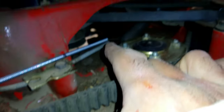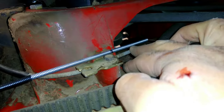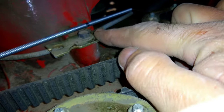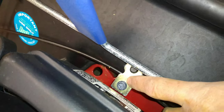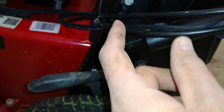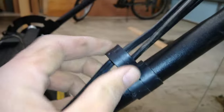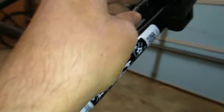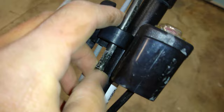Now it's time to fish the cable through the front of the deck and up through the handle. The first spot near the spring looks like it has some tension on it — we want that cable sleeve to stay put — so I put a mark on the new cable with a Sharpie to know where the sleeve needs to stop. There's another spot where the cable feeds through with no tension, then it goes around a corner held by a zip tie. The new kit includes extra zip ties.